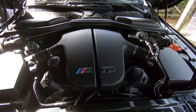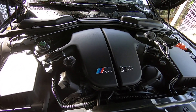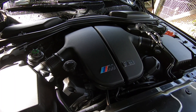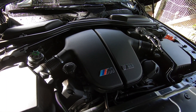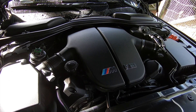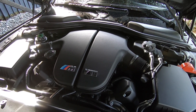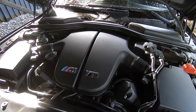As for Vanos solenoid experiences with this S85 — just before I bought the car, it was experiencing issues. The garage that prepared the car initially changed out two Vanos solenoids for the newer type, but that didn't fix the problem. Under further investigation, it turned out to be the Vanos supply line down in the sump. That was replaced, everything was resolved. Nine times out of ten, if you've still got your original Vanos oil supply line, it's likely failing or about to fail. If you're experiencing issues, it's worth starting there first. And if you buy one of these cars with no record of rod bearings being done, and especially that Vanos line, it's worth pulling the sump off, fitting a fresh set of rod bearings, putting a new Vanos supply line in, removing the Vanos pump for a good inspection — and that's pretty much all the big items sorted.